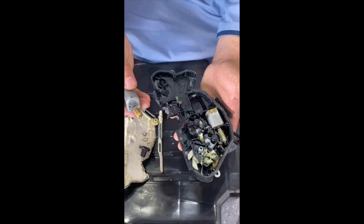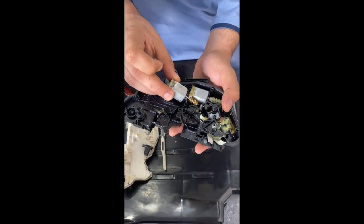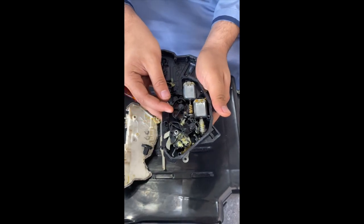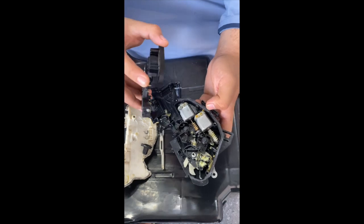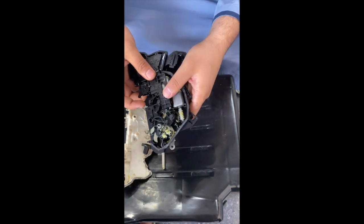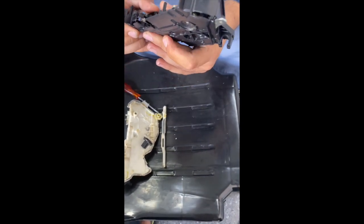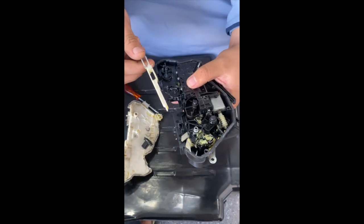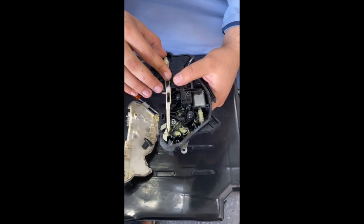The next step is to put everything back together. First, take your motor and position it into that slot I spoke about earlier in the video — just position it in and it'll snap down into place. Next, grab your electronics board and position it so that the prongs on the board are in line with the motors. Please be careful of the micro switches on the board as they are very delicate and could break off very easily. Once your electronics board is in place, grab your manual locking and unlocking mechanism and this just goes into place like so — it stays on quite loose, so don't be alarmed.